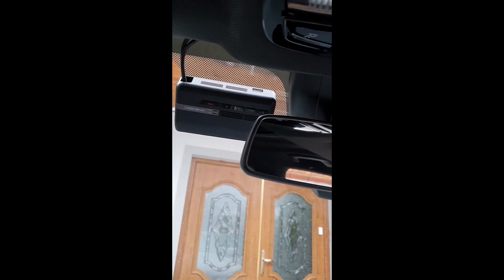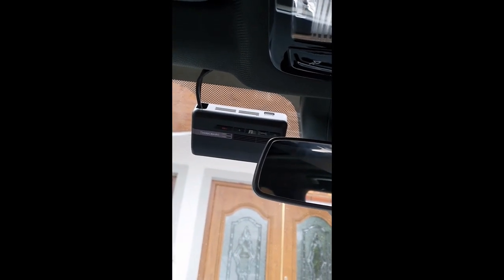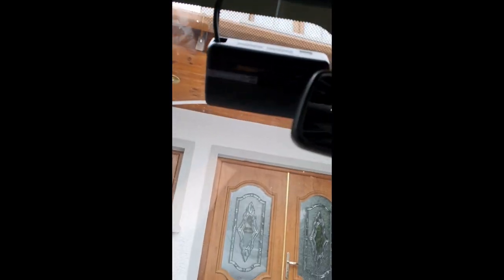That's where I've installed the camera. I've had to bring it down a bit because of the shadow dots that are on the windscreen, and I had to move it away from the mirror here because my mounting bracket unlocks when I move it away like this. I made a mistake to start with — I put it hard up against the mirror and then realized I'd never be able to get it off. So using a bit of dental floss I went behind there and managed to take the old 3M tape off. This stuff is booming good — I got it off eBay. It sticks like the proverbial, but dental floss used in a sawing action gets it off.